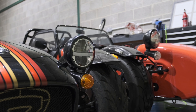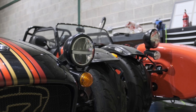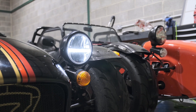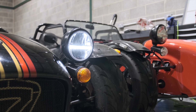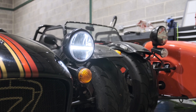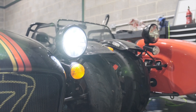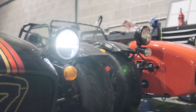Here at Turn 7 we actually have another kind of LED headlight which we personally recommend. It comes in at a slightly lower price than the official Caterham headlamp. The format is very much the same — it has a centrally mounted horizontal DRL which runs through the middle of the headlight, which is a little broader than the Caterham one, making it slightly more visible. The real reason we recommend these lights is for the efficiency, particularly at high beam. Where the Caterham light removes your dipped beam when it transitions to high beam, these lights actually add the high beam to the dip beam, giving a greater spread of light across the tarmac and keeping those verges illuminated — which are the key bits if you're driving through lanes at night.